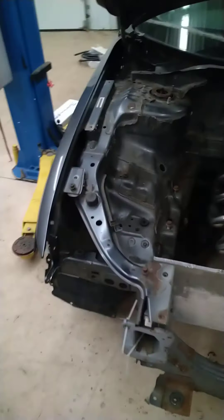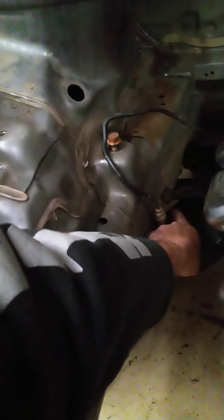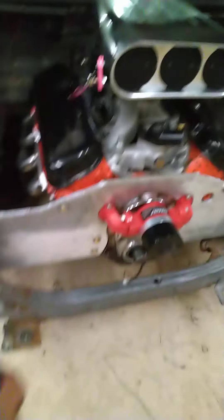The last step I have to do is I ended up having to cut the subframe on the bottom. I was going to just extend the bolts here for the front subframe and drop it down so I can keep the steering rack. But I think instead of making longer bolts and making it weaker, I'm just going to add more pipe right here so that I can drop the whole arm down that way instead.